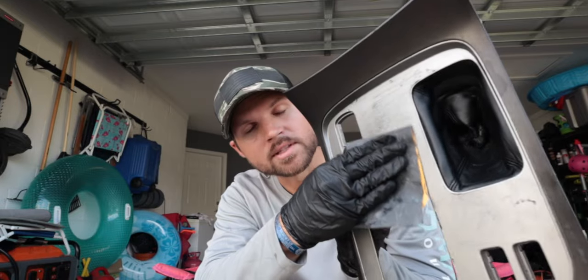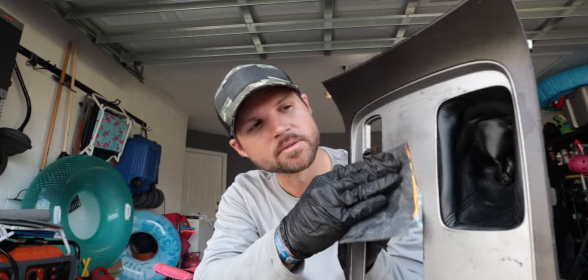I'm a big fan of just using whatever you have laying around if you have the right stuff. I have some 800 grit wet sandpaper, so I'm going to go ahead and hit it with that a little bit. I'm also going to use quad zero grade steel wool. Once you're done with that, you want to get rid of any contaminants, so I'm going to take some rubbing alcohol, clean it all off real good. Then I'm going to tape it off and we're going to paint it. A lot of steps, but it's all in the prep — the prep is the most important part.